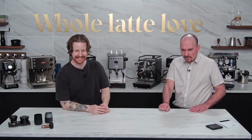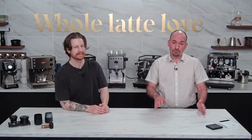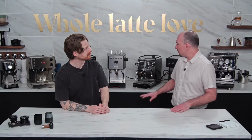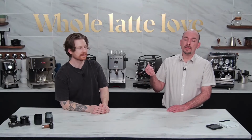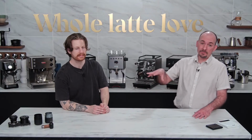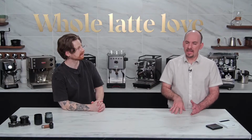So what does active pre-infusion mean on the settings on the Synchronica 2? Yeah, so Stelia, that's a good question. Active pre-infusion means that the pump is actually running to pump water to the group, okay? With the Synchronica, because you can plumb it, passive pre-infusion is going to work a little bit differently on this machine, because the way that you start your shot is you lift your lever. That means that if you have active pre-infusion turned off, but you have passive pre-infusion turned on, which you can do, you're simply letting the line pressure flood into the group, right? So active pre-infusion is more so if you don't have your machine plumbed in.